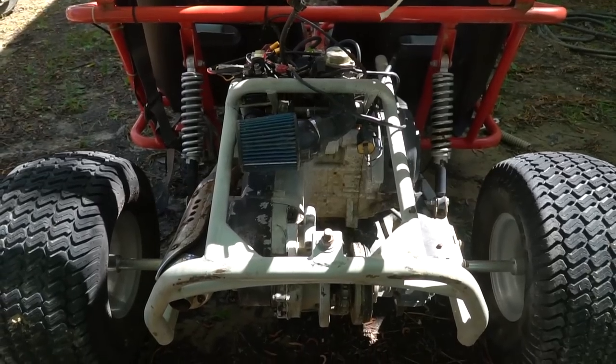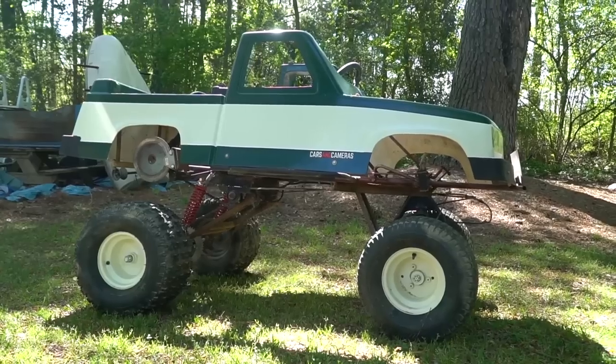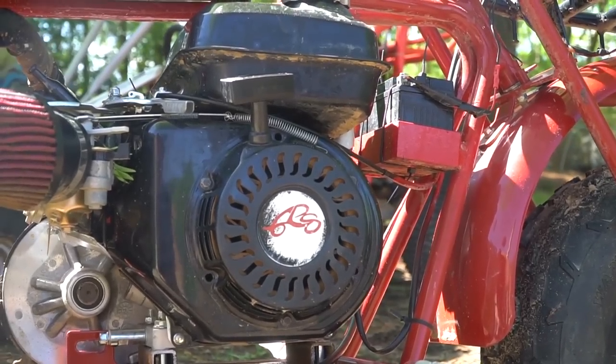A lot of our projects did pretty poorly. The GY6-powered Yerfdog did pretty good, but it had some breakdowns — it was the first time out. We had carburetor issues and a CDI box fail on us, and the turf tires did not do well in mud. Moving on to the ATV, we never fixed the jetting on the carburetor, so it ran terribly. The monster truck also did pretty well, but it's still very tippy. And finally, the Coleman CT200U with the Coleman performance kit from Go Power Sports — basically a stage one kit plus a torque converter and a 60-tooth sprocket — was very reliable. It's like the old school Willys Jeep of the minibike world. Simple, but it keeps on trucking.